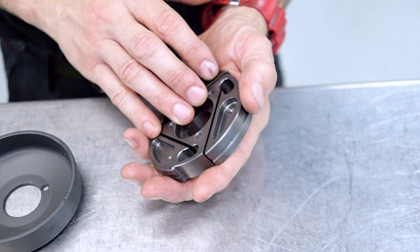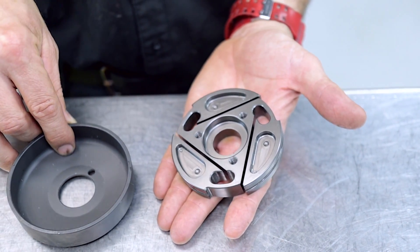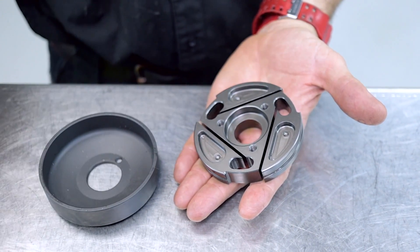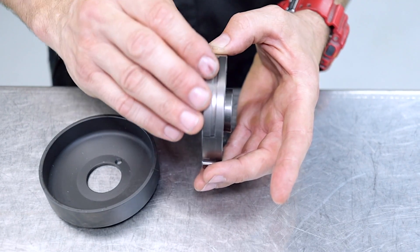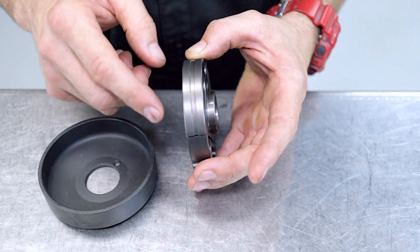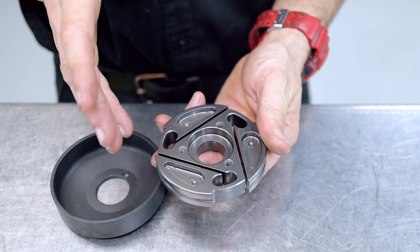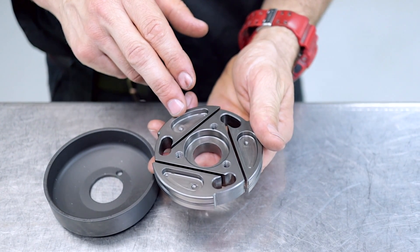As you can see, we've got metal clutch shoes on a metal clutch drum. Both of these things have been engineered and heat-treated — there's a lot of science that's gone into the material choices. We're trying to get the best longevity while still performing excellently, because some of these things have given us trouble before. There's no friction material on the shoe, so we're not going to get clutch wear. These have been hardened and there's a speed groove down there so we get better bite with the shoe on the drum. This is a trailing shoe, so it won't give you the engine braking, but we do get a little bit more freewheeling going into the corners with less wear and less load onto the clutch under braking.